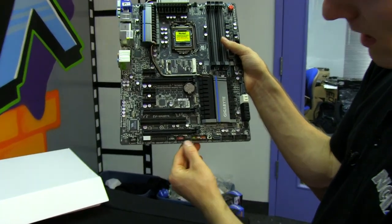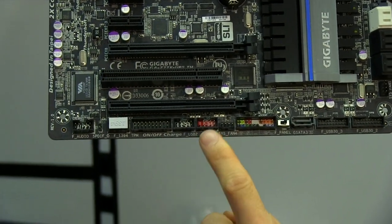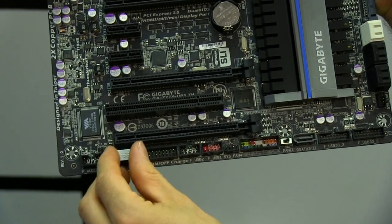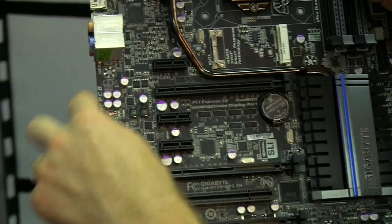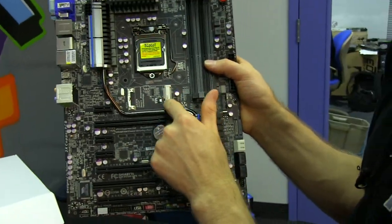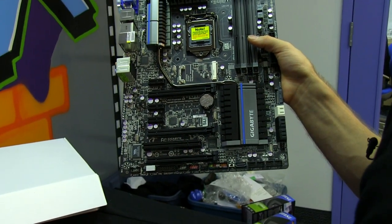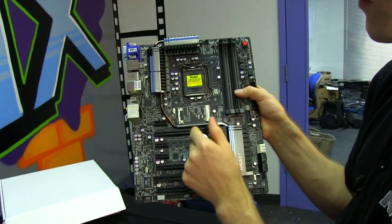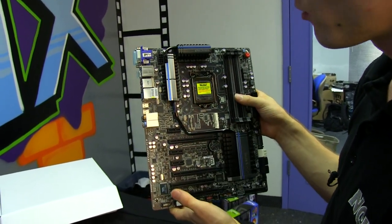Front panel connectors are here, as well as a high-power USB 2 front panel header and a normal USB 2 front panel header — the high-power one is better for charging things like iPads or other tablets. There's also a trusted platform module header, front panel FireWire, front audio, and onboard audio. There's also an mSATA port — populating it will disable SATA port 5. You can use it for Smart Response Technology or even just as a regular SSD; totally up to the individual end user.